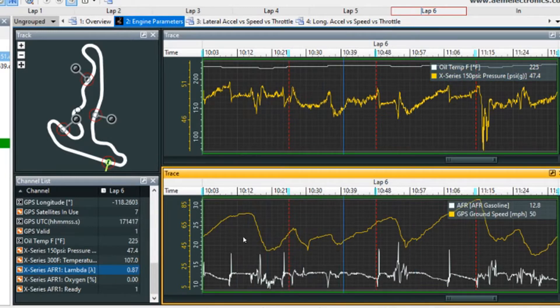Overall, the data is going to help me start altering my air-fuel ratio with my Aeromotive fuel pressure regulator. As you can see here, it's still 11.5 to 1 as I climb, and you can see it tapering downward, adding more fuel as we go through, getting close to about 11.2. I actually leaned it out a little while at the track because the last log showed it was in the tens. It looks like I still have a little more to go, and maybe I can get a little more power up top to help me on the long straightaways. Alright guys, that's about it.